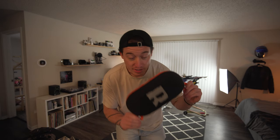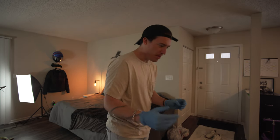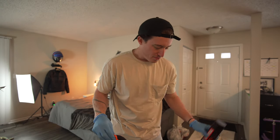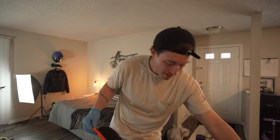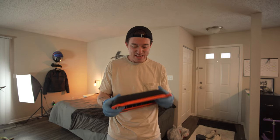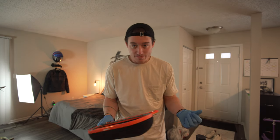It's been a day or two and this thing is finally completely dry, so now it's time to oil it up before we put it back in the bike - and that means more rubber gloves. I'm going to be using this Motul oil spray. I've used this before when I first put it on the bike and I think it's better than the gel stuff that comes in a bottle. I prefer the aerosol spray because traditional foam filters on dirt bikes don't have all this plastic ribbing to hold their shape, so you can squish them and knead things in. You obviously can't do that with the Rottweiler ones, so I prefer to just spray it on.